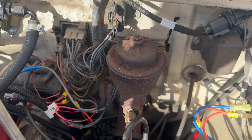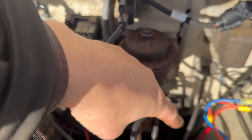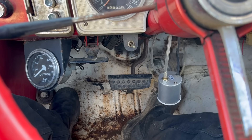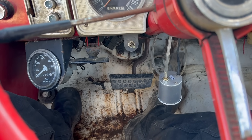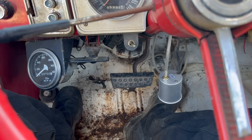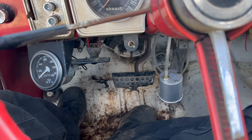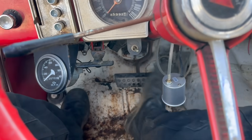What you could call a single pot, or what we enthusiasts love to call the pump and pray. This system uses one large cylinder, one line, and a distribution block that goes to all four brakes. It's a simple, robust, and very reliable system — at least until you spring a leak anywhere. Because if any of your four brake cylinders lets some fluid out, all of a sudden your pedal's going to go all the way down to the floor, and you're going to have a bad time.